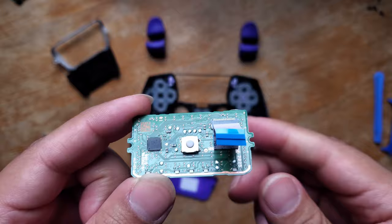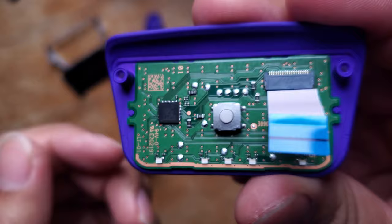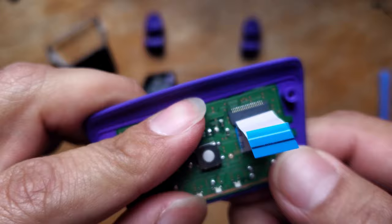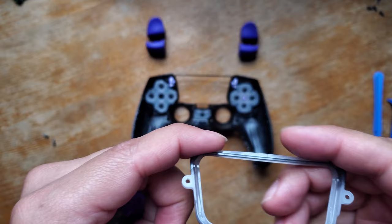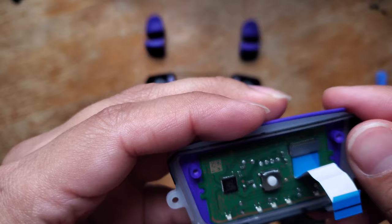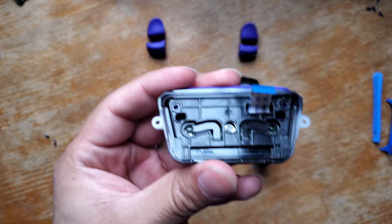I'm back — that part's always a bit of a process but I got it done. This is what the back looks like because of the glue. Here's your new touchpad — you just have to align these two little parts together, then you can squish it. Because of the glue, you could even reapply heat if you have to. Next, grab this piece, place it on top, then your black one — put that cable through it, then put the screws back in.